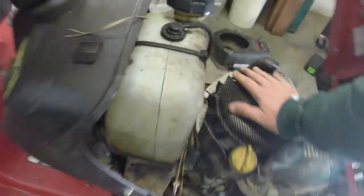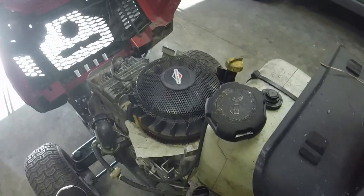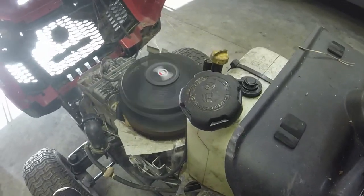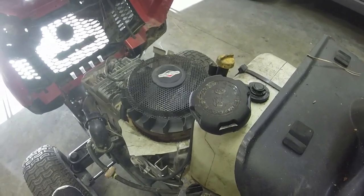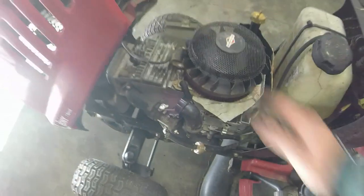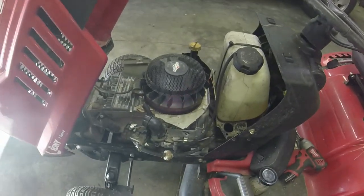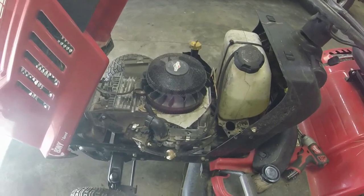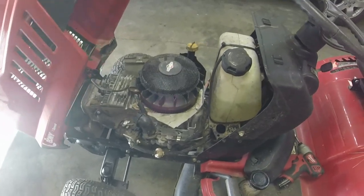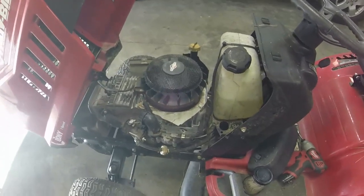Let me show you real quick — it's not going to kill the starter if I do this once. You push the brake in, I've got a good battery — about 375 cold cranking amps — and it gets right there and it won't go. I'm not going to pump it anymore because I don't want to mess up that starter. Sometimes if you're lucky it's valves, but this is definitely a cam issue. He said it's been starting hard, just all of a sudden starting hard one day.